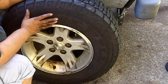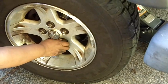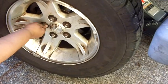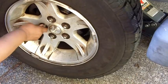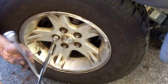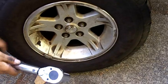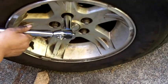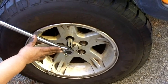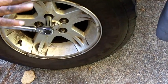Now it's time to put the tire back on. I gotta tell you, this is the part of the job I don't like because these tires weigh a lot. I'm going to put the lug nuts on hand tight, then tighten them slightly with the lug wrench. Then I'm going to have to torque the lug nuts. I just want to tighten them enough to lower the vehicle to the ground — right now the Jeep is still up. I've got my torque wrench set to the specifications, and I'm going to listen for that first click. Once I hear it click, I know that it's torqued to spec.